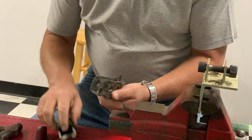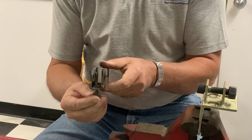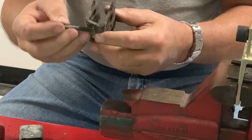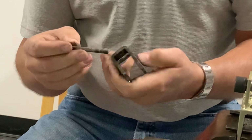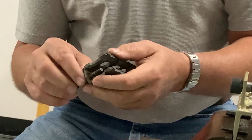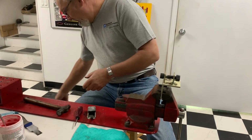And I see exactly why. They're supposed to be where the pivot pin goes through. There's supposed to be a wave washer, and the wave washer's gone. And the wave washer would take up the space. That's why the little bow tie is bent. So when we rebuild this and put it back together, in the kit, a wave washer comes in and a new friction washer in the front, and everything is going to be just a beautiful thing. So that's all going to get cleaned up.